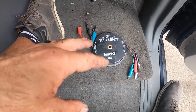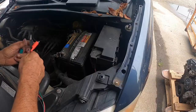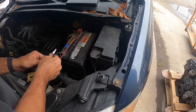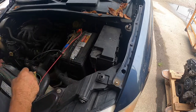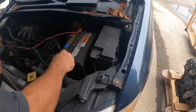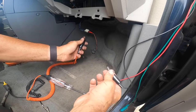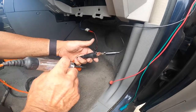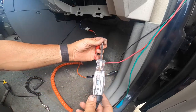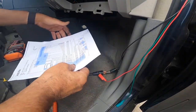Whenever I'm testing electrical components on a car, I always grab my test leads and hook them to the positive and ground side of the battery — that gives me my best readings. Red to positive, black to ground. I'm going to go ahead and stick an extra wire on the ground side just in case I need it. After I got the jumper leads hooked up, I check my test light to ground and we have 13.9 volts, so we're good.